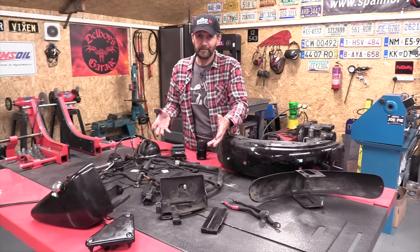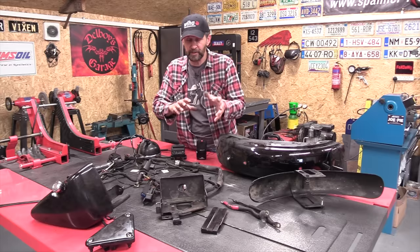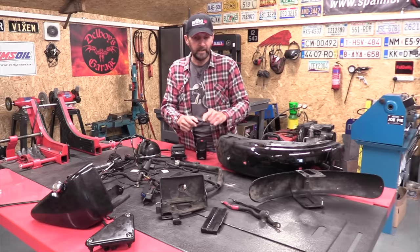And also while I was looking at that metalwork, I checked out the oil tank and these mudguards, they're awful. The mudguards are going to get a bit of surgery. They're going to get chopped up, but the paint needs to come off them still. So today instead, I'm going to suspend the wiring loom. I can do that job later, put that to one side and get all this metalwork completely isolated, strip all the paint off it and get it prepared. Because tomorrow I've got a full day booked at the paint shop. Let's do it.